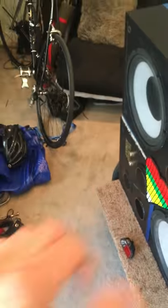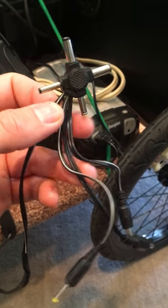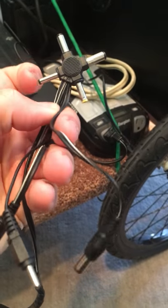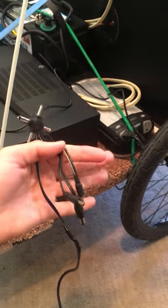This shoots a beam of a bunch of lasers behind it, which people seem to really like. The way I powered that — I didn't want to run an AC adapter off of an already DC system — this inverter happened to have a couple of USB ports on it. So I took an old cable, put a good length — about 10 feet of wire — on it, and stuck a USB connector at the other end so I can power any 5-volt device with this. My Bluetooth adapter was powered this way, and the laser show as well. It's pretty universal — I can just plug that in and power anything I want off of it.